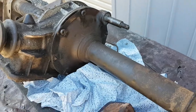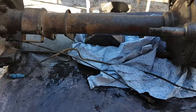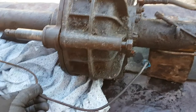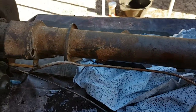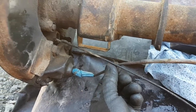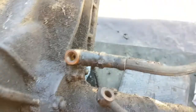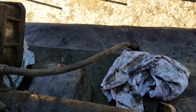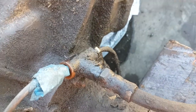First of all, what you'll need to do is get hold of at least one of the brake lines and disconnect it. This brake fitting, this hard line here, is held on by clips against the actual diff itself, and you'll see it connected up into the brake itself. The other end flows round and fits into a three-way fitting up here. We've got a flexible line that goes to the braking system and the other hard line goes round there.